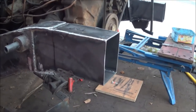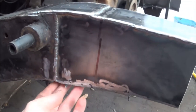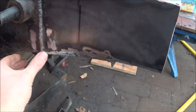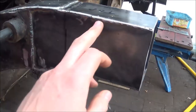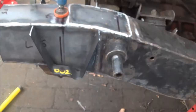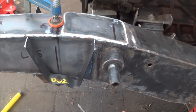I've welded the extensions on. I've put a strengthening plate on the top just over the joint, and combined the bump stop support with an extra strengthening plate to carry on there. The normal support would end here, but I've extended it another 80mm back to cover the joint and stiffen it up. The next job is putting in the supports for the bump stop — you can see the bump stops I've made, lined up in place at the bottom as a jig, and I'm going to weld those on now.